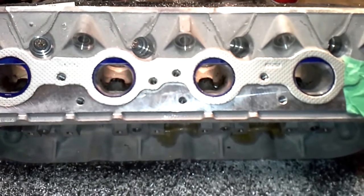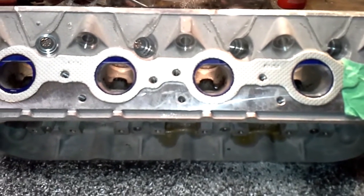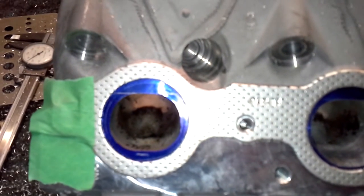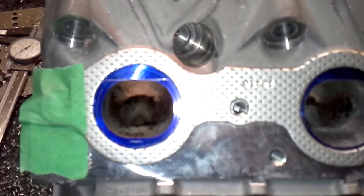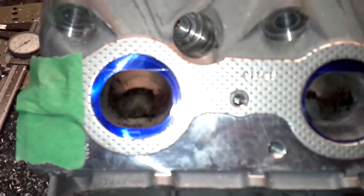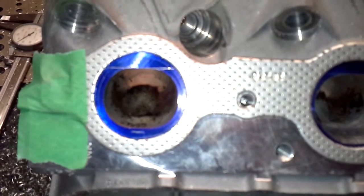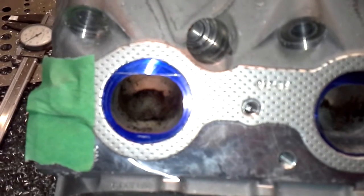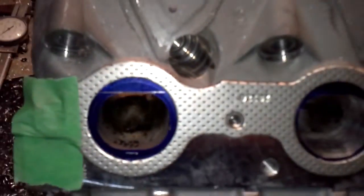These are number 241 LS1 — and I do mean LS1 — these are the 5.7 cylinder heads. If you look at the blue layout dye, you'll see a little line that I scribed, just rudimentarily scribed, where the floor of the port is. Then you can see where the gasket comes out to. If you look inside the gasket but outside of the port opening, you can see where the stock manifolds were burning black on the head, almost like a scribe line where the exhaust was burning.